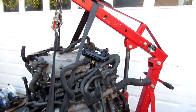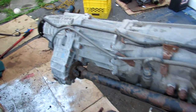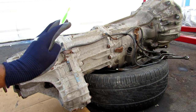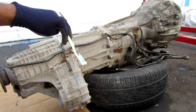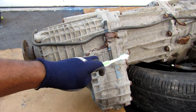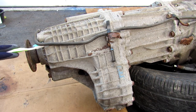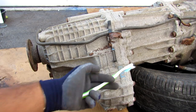The engine is out on the crane here. You can see just how long this transmission is due to the four-wheel drive transfer case that comes up to the front differential. I've already got a full teardown on this exact transmission and how it works, so I'm going to link that in the description if you want to see how everything works up to here. For the purpose of this all-wheel drive video, we're going to be focusing on the transfer case section. The transfer case is responsible for taking the output from the transmission and transferring power from the rear wheels — which is what this vehicle is biased to — to the front wheels in case of slippage or depending on the drive mode.